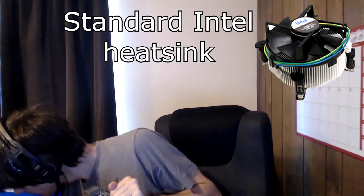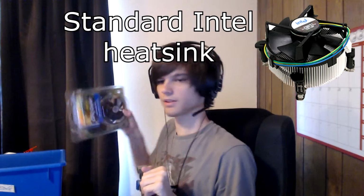I have a cooler down here as well. So this is for a much older computer, but they'll look the same. Some of them are a lot bigger than others, but all you have to do is there'll be a plate on the back and some holes. So you can see here's where the CPU is. It's going to be 4 holes here, here, here, and here. And you're just going to have to mount a plate back there, and then you'll mount it right on top. It's not too easy the first time around. That was probably the hardest part for me, but after that it's very easy.